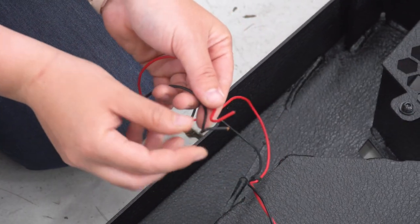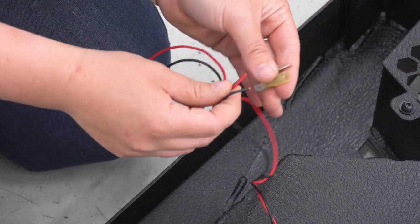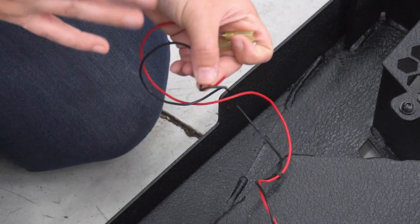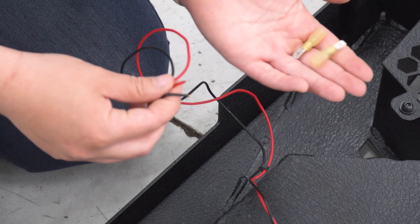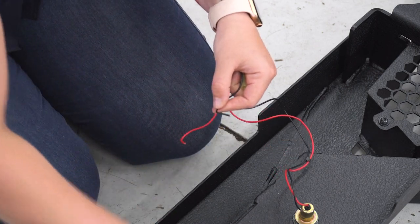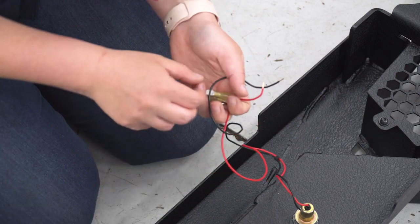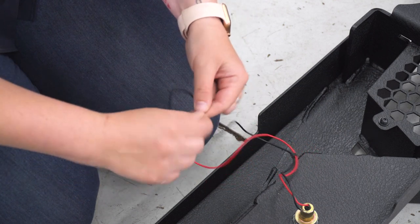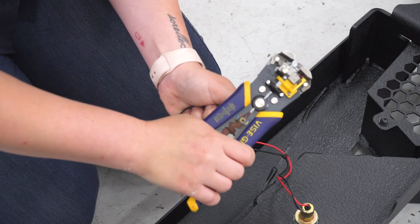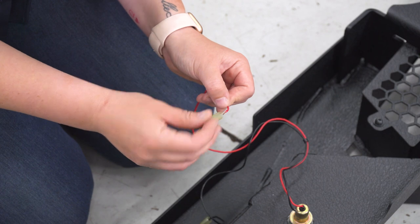After our light is in there, what we need to do is make sure that our leads are ready to be plugged in to our license plate light. I already have quick disconnects on there, so what I'm gonna do is add a spade connector so we can connect them to the quick disconnect that's on our truck. You can wire this up a number of different ways — you can wire them directly into the backup light — but if you ever need to take your bumper off in the future, I recommend a quick disconnect. I'm gonna strip some of the wire casing off, grab a spade connector, make sure the wire is twisted and clean, put that in place and crimp it down. I also recommend that you heat shrink these or put some electrical tape on just to make sure that they are waterproof and secure.